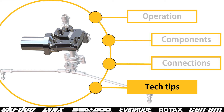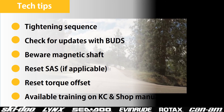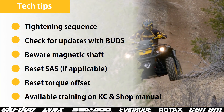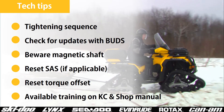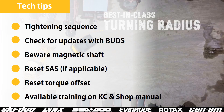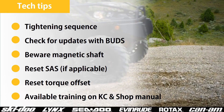And finally, a few things you should know when working on units with DPS. It's very important to follow the tightening sequence in the shop manual. This sequence ensures that you don't induce a ghost torque into the DPS because of misaligned steering components. When connected to BUDS, always perform any available DPS updates. As a general precaution, keep anything magnetic away from the steering column and DPS module, especially magnetic trays for holding bolts. This is also true if welding in the area — do not ground a welder anywhere near the DPS module. Always perform the proper DPS module resets as per shop manual procedures when servicing DPS modules. Search the Knowledge Center and applicable shop manuals for information on specific models.